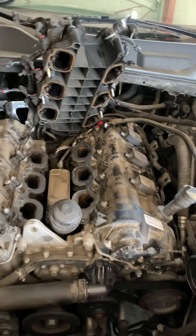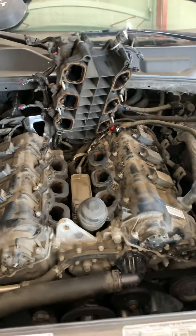I just have a bungee cord up here, kind of lightly wrapped around the wiper arm to hold the intake out of the way. Then wipe this off, and the oil pressure sensor is right there — literally about 15 minutes. I've seen guys do all kinds of stuff to try to work around pulling the intake and it takes probably a couple of hours. Then you're fighting things and you may not be able to get the sensor threaded in well. Just pull the intake — it's very easy.